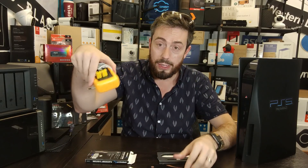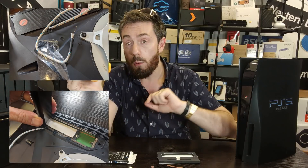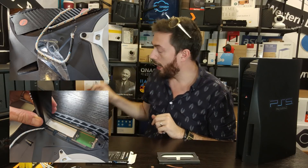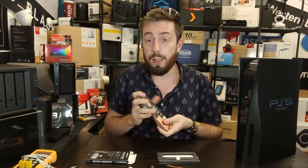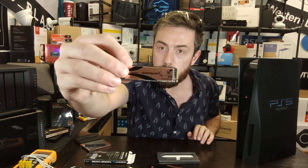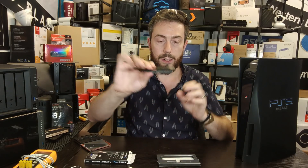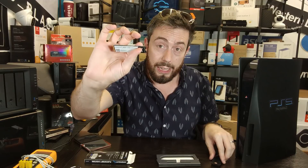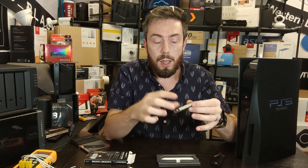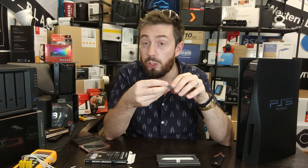During our testing we'll be using a two-node temperature sensor. One sensor will be on the controller chip of the SSD; the other will be outside of that cavity bay. We've got a Sabrent SSD here — this is the 4TB model — and you can see it's already quite a chunky SSD. I'm looking forward to seeing how well it fits inside that cavity. A two-sided SSD should still not be a problem because of the way they're raised with the key at the back.